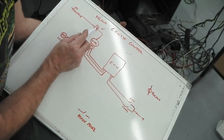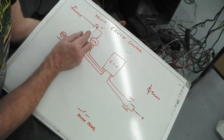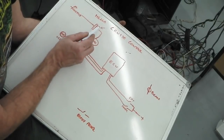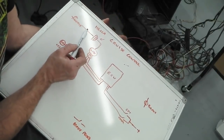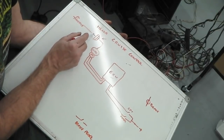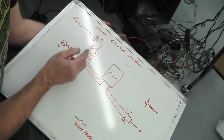They draw on the bellows, and because there's no air leakage, the bellows will stay wherever they stop. To get them to expand back out, there's a little dump valve which lets air back in. So all this does is draw in and out, depending on whether you're operating the dump valve or drawing air in to create a negative pressure which atmosphere pushes on the bellows. That creates quite a bit of pulling force, Newton meters I think, which pulls on the throttle cable with enough force to open your throttle, or lets the throttle spring back. So that pump is how the ECU controls the revs.